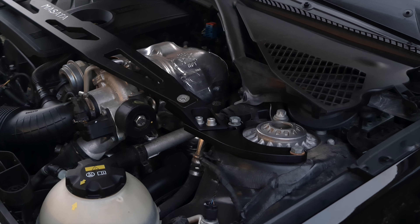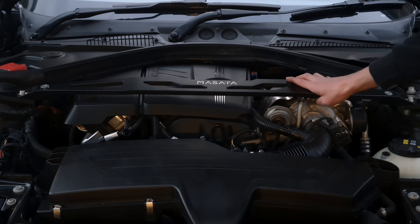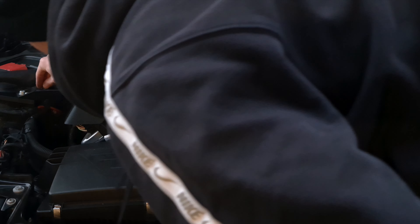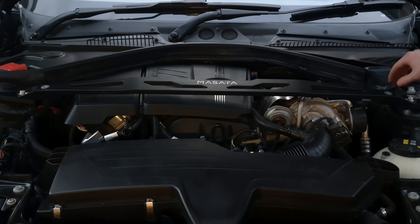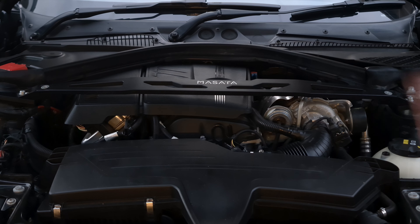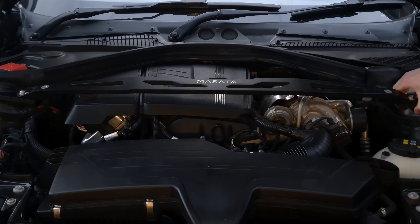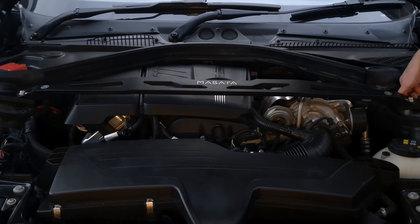You can get a rough idea of what it's going to look like before I've tidied it all up. This is what the strut brace looks like — everything is still pretty loose, so that's not what we want. We want it to be somewhat tight. I'm going to go around each bolt and put some thread locker on them, and then start torquing them down fully and up to spec so that I know these are connected properly.